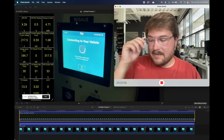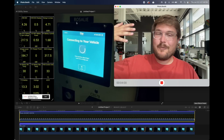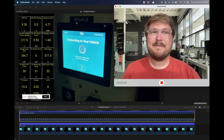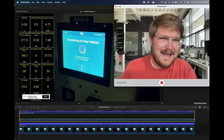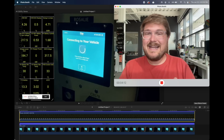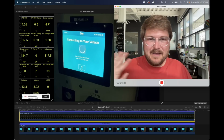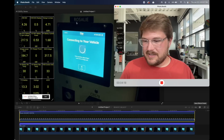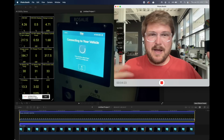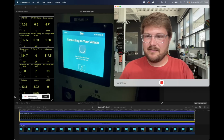Just for comparison's sake, the Rivian R1T, which I have other videos on, will request the full 500 amps, but all the way up to about 440 volts. And so the Rivian can do like 219, 220 kilowatts, where the F-150 Lightning, for just a little bit less amperage, can do about 170, 175 maybe peak. And so that's the benefit of voltage. But that's really the only benefit of high voltage. There are some others when driving, but the battery pack doesn't really care either way. Again, topic for another video.